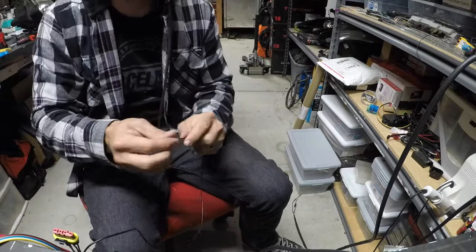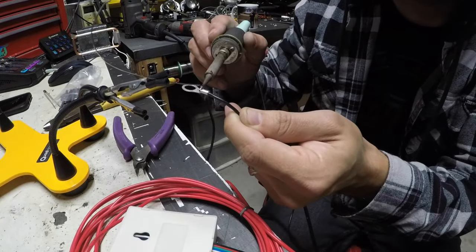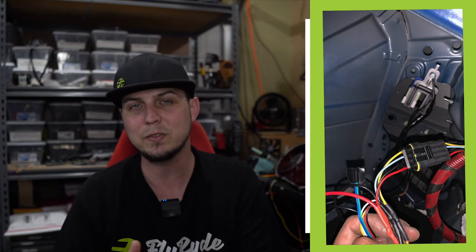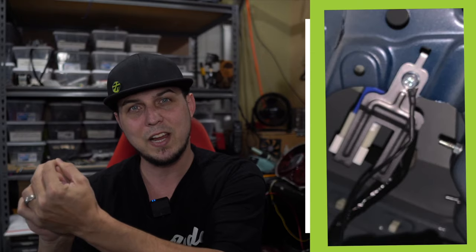Unfortunately, it doesn't stop there. You also have to know where different points of the car are better for things like the ground connection. You want a perfect place that's convenient, out of the way, solid, and easy — nobody's going to have issues with it over time. On this GTR on the passenger side, there's a bracket behind the taillight where you take a 10-millimeter bolt off, stick it back on with a loop terminal pinched between the chassis and that bolt, and you've got a solid ground. It doesn't have to run all the way to the battery — but the power wire does. This is why it makes sense to do the same kind of car over and over so you really get to know its layout.